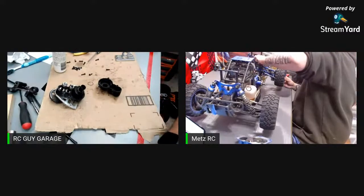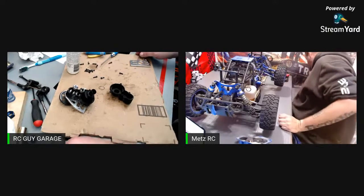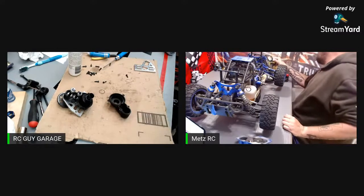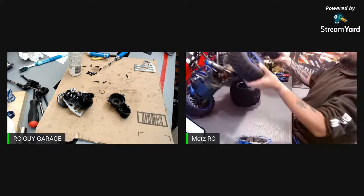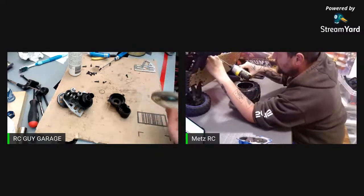What you working on? I'm going to put these new shafts in this transmission, but I'm going to go ahead and pull the engine on it while I'm at it and double check all the screws and put stainless steel in most of them and some Loctite. Because I'm tired of this thing falling apart in the middle of my videos, and I look like a dumbass. I could have got a lot more runtime out of it on my last video, but whatever. I'll get it fixed.